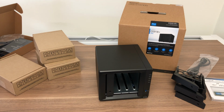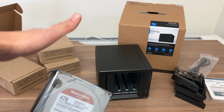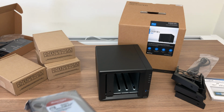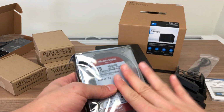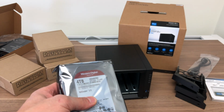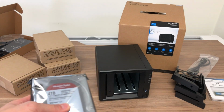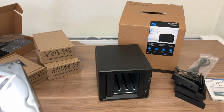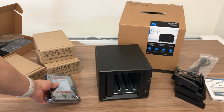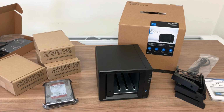Now, these aren't like the top of the line ones. This is the Red series, the Western Digital Red series. So it is meant for like a NAS or something that's going to be on 24/7. But they have higher performance or higher tolerance versions. And again, this is only 5400 RPM. You can get the 7200 RPM, but again, you'll be paying a premium. I think these were 125, and I think the 7200s were 180 on Amazon. But again, I'll drop the link below, guys. So I got 4 of these. So what I'm gonna do is I'm gonna set everything up. I'm gonna put in the RAM, and I'll be back and show you guys what it looks like.